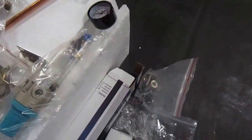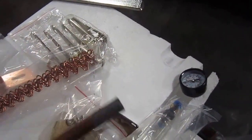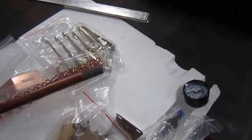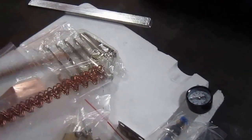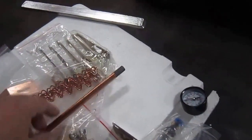This is the thing I was talking about that heats up — it's like a carbon tip. Basically what it does is it heats up and you can use this for shrinking panels, so instead of using a stainless steel shrinking disc and rubbing it all over the panel and then quenching it, you just put this on and then quench it. You're heating much quicker and the shrinkage will be quicker as well.